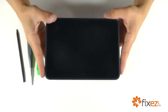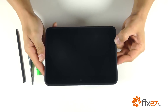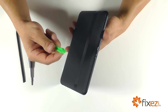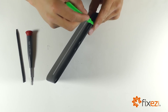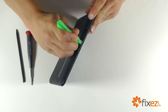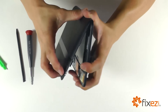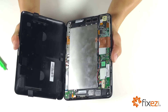To begin our entry into our Kindle, we want to try to work on peeling off the back cover, starting with our plastic opening tool in the seam that surrounds the perimeter of the Kindle. Gently slip the tip of our plastic opening tool into the seam, and using a gentle prying motion, you should start to separate the clips that hold that back cover onto the Kindle. Working yourself around the entire unit should free up the back cover for removal.